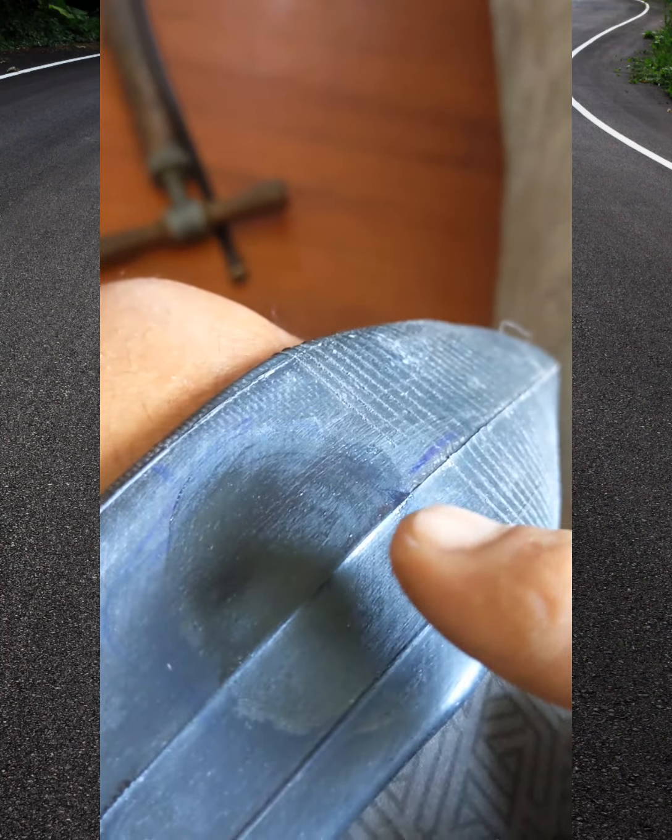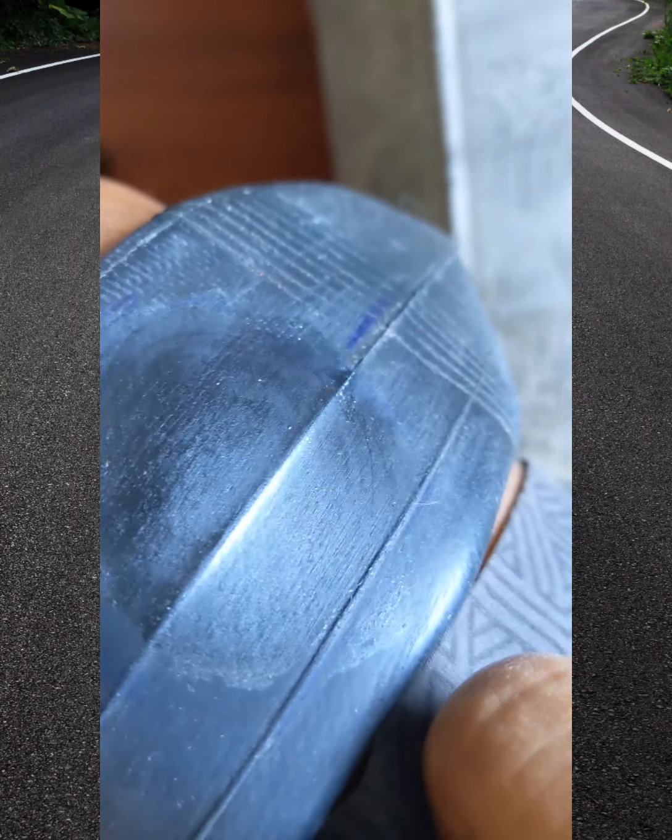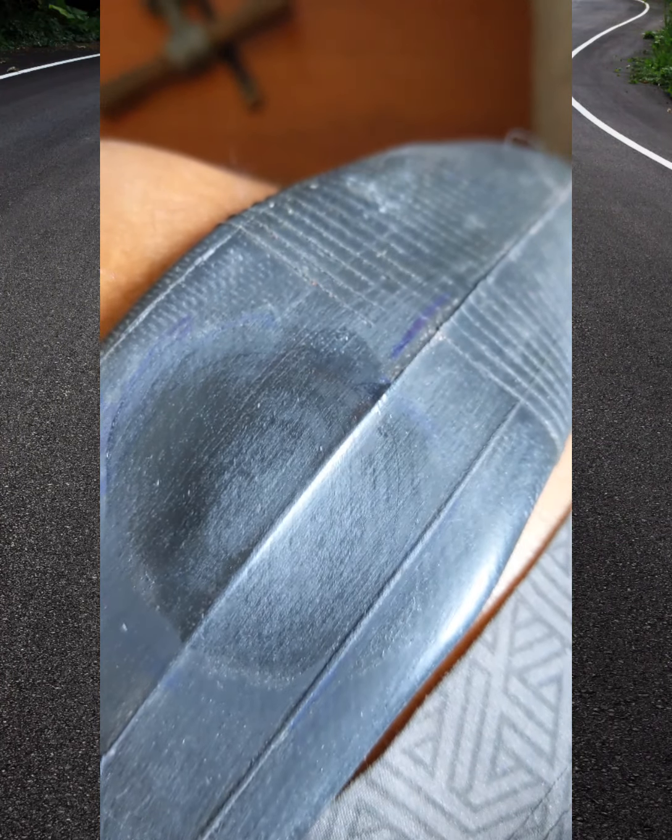Yeah, sometimes if I try to touch it right now, it'll be all gooey. Let me show you what I mean. Like say we just rubbed that on, right? Now watch. Now I'll try to rub it again, that little section I just did. See the glue? It's already starting to get sticky. Now see that if I were to try to go back on it again, see what happened? Basically it got sticky and it failed. This is a failure. It has to stay shiny like that, and it has to dry a little bit, and then it gets a little sticky. Let me put that on.